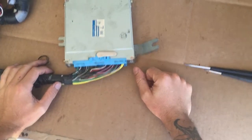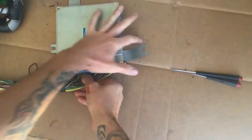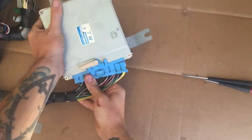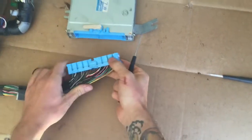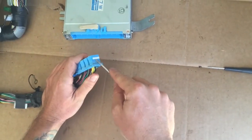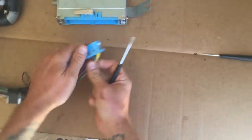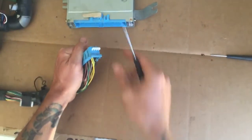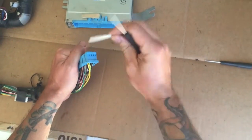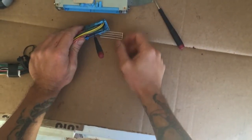Here's a quick video on how to de-pin a single connector Subaru computer connector. Just unlock that — this one has these two clasps, one for each bank. Take a screwdriver and work that one out. It's just kind of like a guard. The ECU came from an automatic transmission.